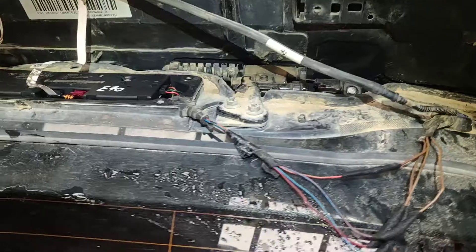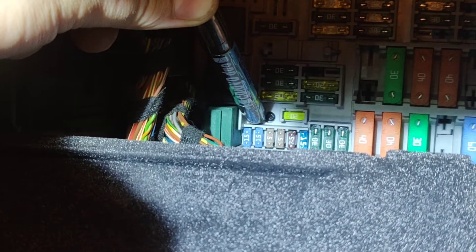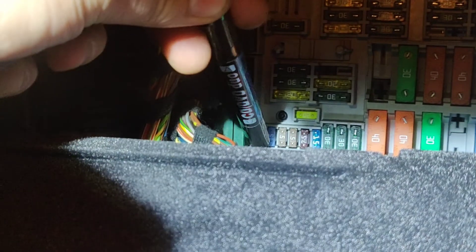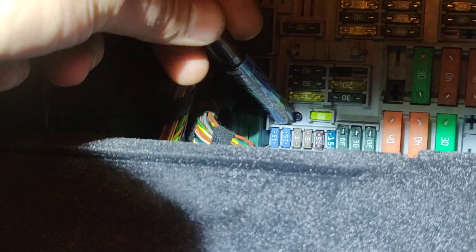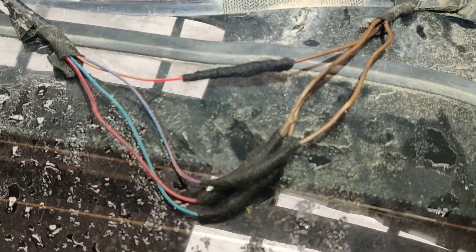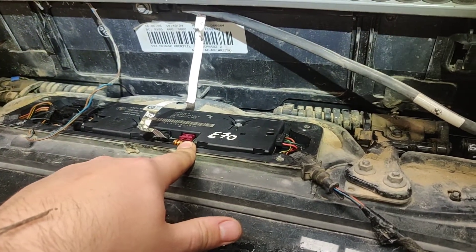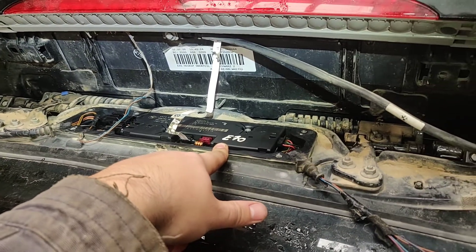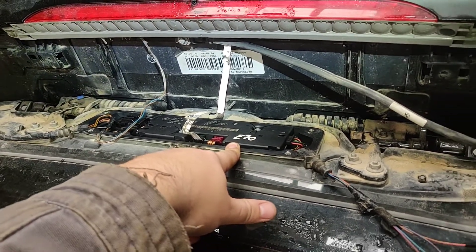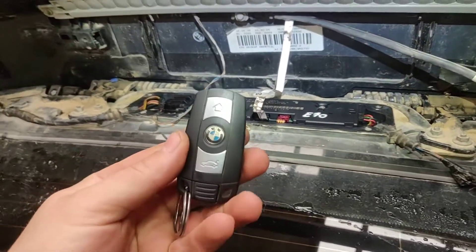I hope in your case it can be the wires that are broken, or it could be the two fuses — the 15-amp blue ones in slots 56 and 57. Always check those first, as they can be blown. In our case the fuses were fine and the wires weren't great either, but ultimately the problem was the module. We exchanged it with one from the BMW E70 X5 second generation, and it fits. Thanks for watching, good luck with your diversity module and central locking problem.